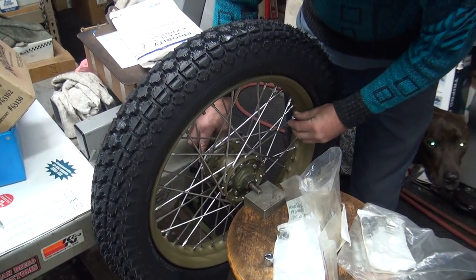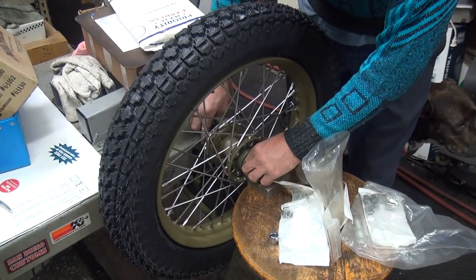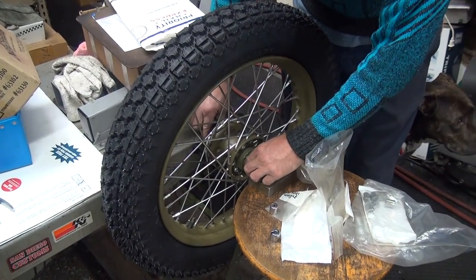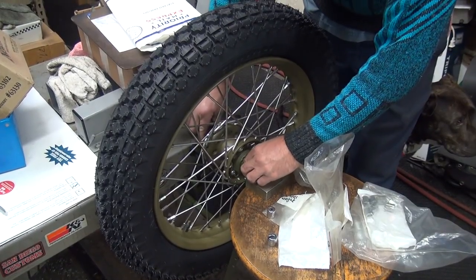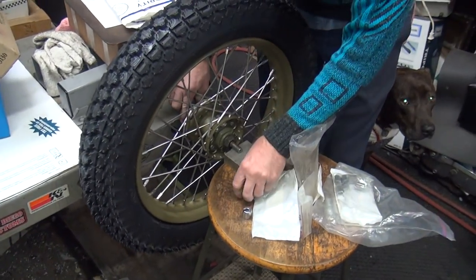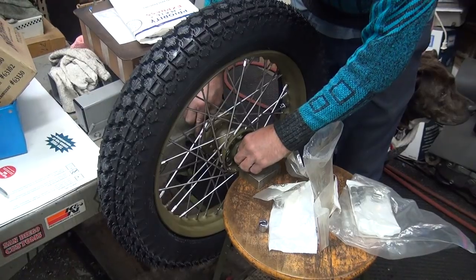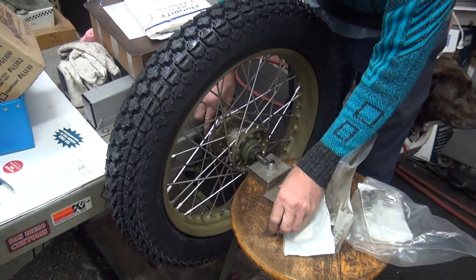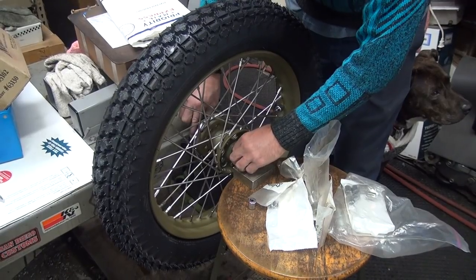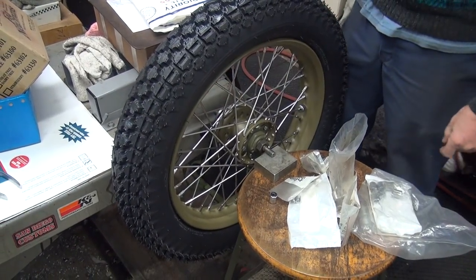Right about there. Down one. You had a down one. I know it was over here. Having bearing drag makes it difficult. It doesn't move at 3/4. Mm-hmm. Is it starting to drop a little bit? Mm-hmm. Okay, so we need 3/4 of an ounce of lead.